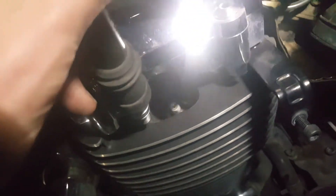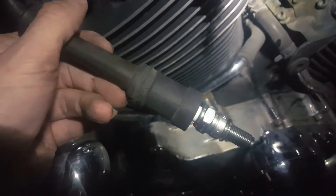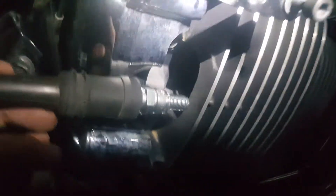And then if you take off one of these terminals, or just across one terminal — this is where, by the way, that wire that comes out of here, this is what leads to your spark plug. I put a new spark plug in to test it. You can test to see if the spark is happening. I just used another spark plug that I have and tested it on the ground of the cylinder.